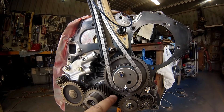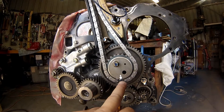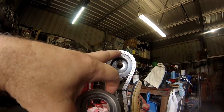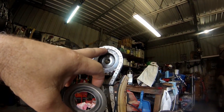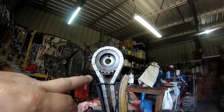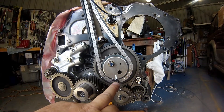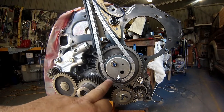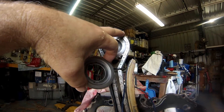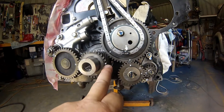The timing chain has 49 links. This particular chain - I've only got where the join is. Some have an actual discoloration link, and up the top there'll be two discoloration links - like a black one and a black one - so you get two marks there. So 49 links total: 24 up to there, and then from here down I counted 24 to here, and all my marks line up.